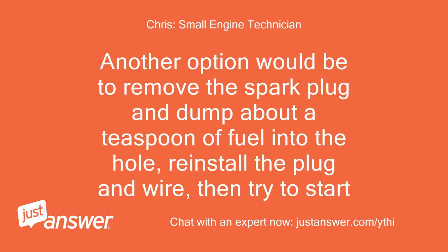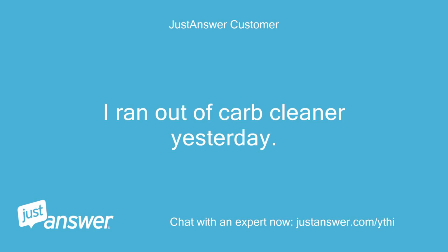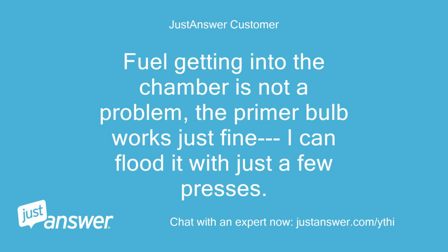Another option would be to remove the spark plug and dump about a teaspoon of fuel into the hole, reinstall the plug and wire, then try to start. I ran out of carb cleaner yesterday. Fuel getting into the chamber is not a problem, the primer bulb works just fine, I can flood it with just a few presses.